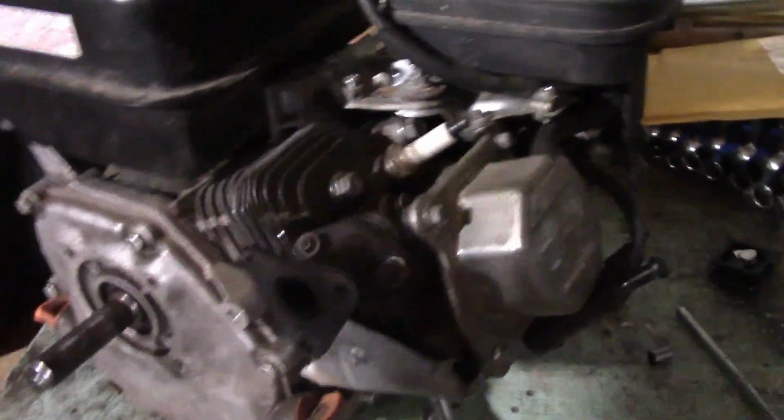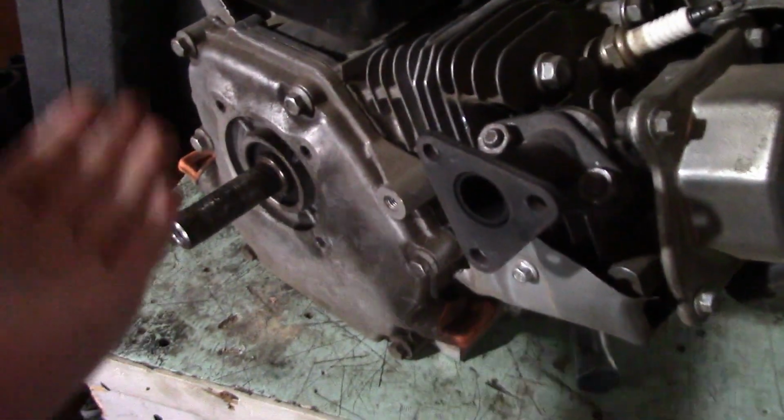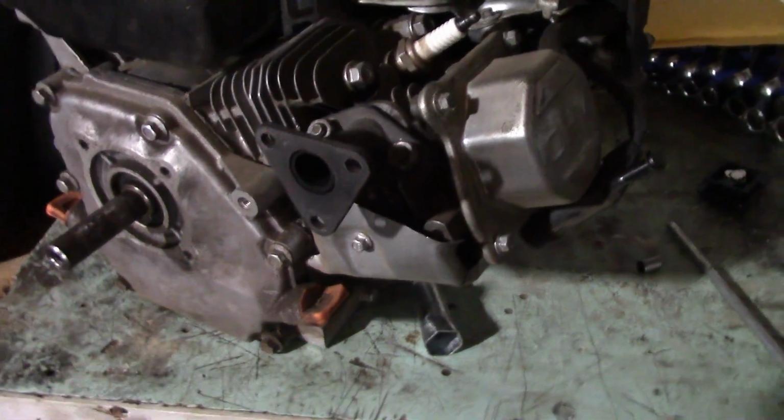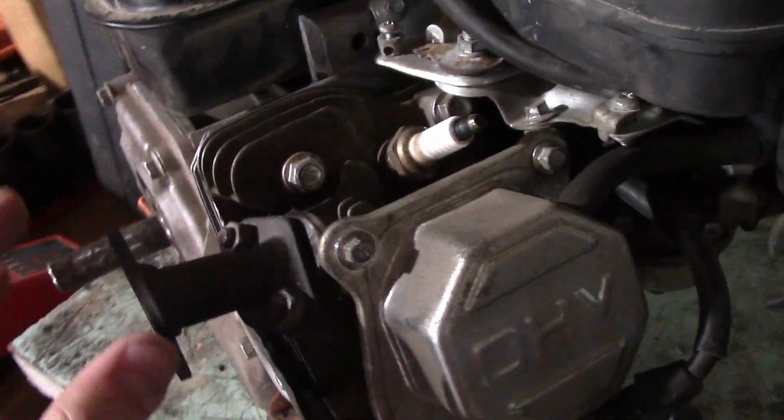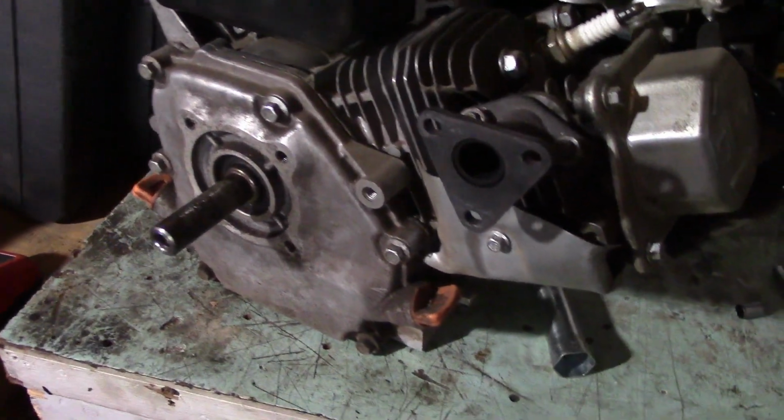Hey guys, Ford 36 here, and I'm going over this motor. It's degoverned with a high compression head, and obviously I want more revs out of this thing. Considering I haven't done a whole lot of other things, I don't think the motor's in any unnecessary stress, so I went ahead and bought some 18-pound valve springs to install.